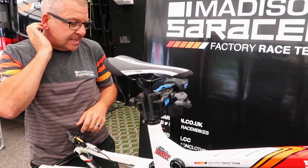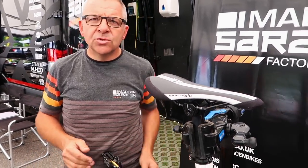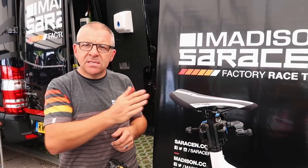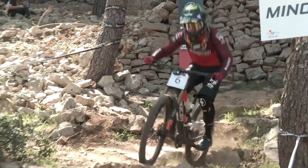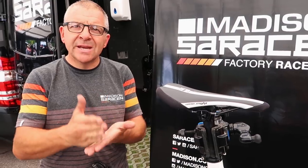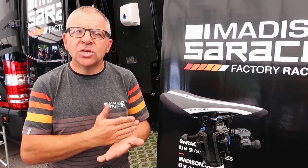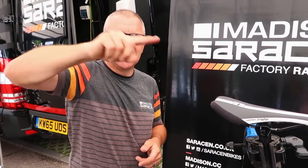Here last week when we were testing, we had some small initial issues with lateral movement of the bike, which is another thing that this central sensor does. It measures how much the bike is doing this, especially in the chop. Is that like being able to tell how well the wheels are tracking, or the suspension is tracking the ground or skittering around? Yeah, in very basic terms we're just measuring how much the bike is doing this. It goes from really bad to that, and we can see what that looks like on the graph.